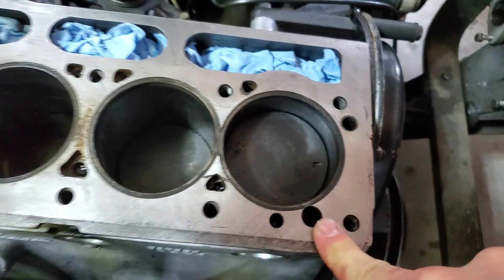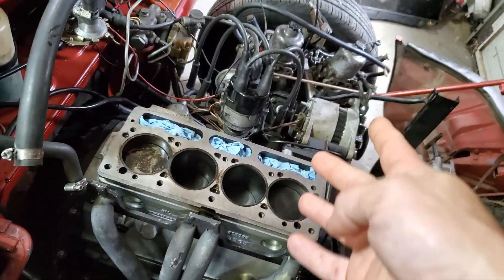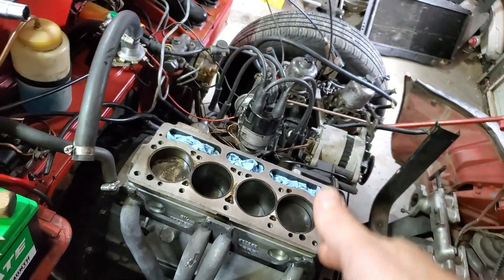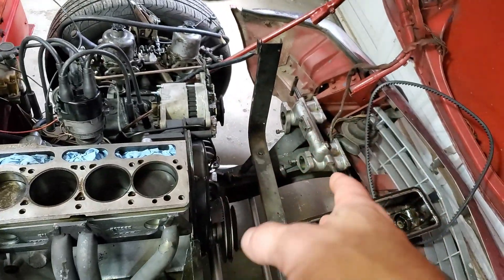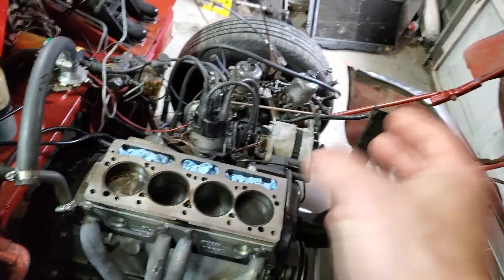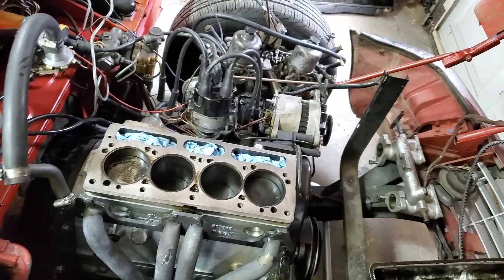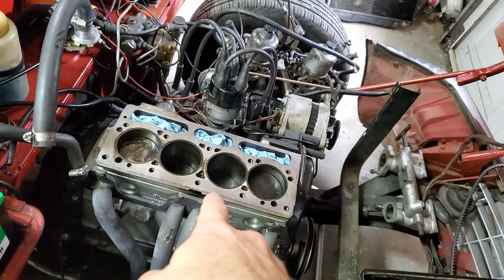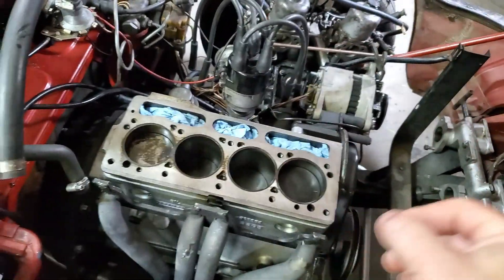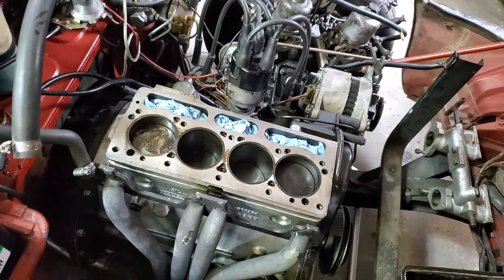So that's what we're going to do today, and hopefully if you're having this problem you'll see how to fix it. I've gone through four head gaskets. I've got Payen brand ones and I've got Felpro — Felpro just sends you Payen. The third one seemed to be doing alright, and then I blew a radiator hose which blew the head gasket. Put in the fourth one and it lasted like ten miles and blew. So I'm getting a Lucas head gasket, which seems to be better. What I'm going to be doing is mix up some JB Weld, put that in there, let it cure, and I'll show you how I'm going to get the block face flattened and level again.